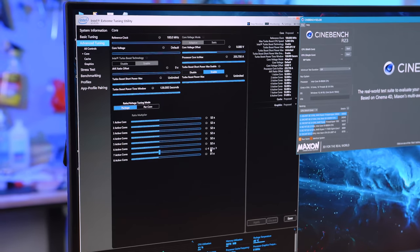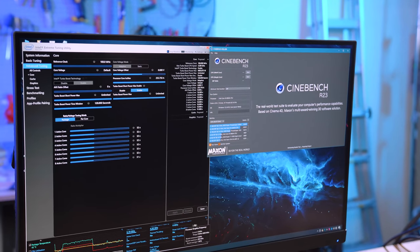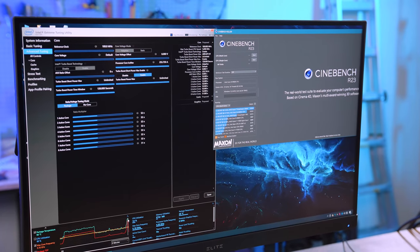We put the lapped CPU into Phil's build. The major difference is this is a 280mm AIO from Cooler Master, not a dual 240 rad custom block pump combo with a better cold plate. Loading Phil's saved profile — 5.1 GHz all-core, 5.2 on seven cores and below, with an 80 millivolt offset — we're seeing voltages hitting 1.43 to 1.49 volts and 96°C. That's 1.5 volts on an AIO, which is far too much. Phil said his old CPU didn't get that high — the voltage algorithm is not a copy-paste between CPUs; it's based on ASIC quality.